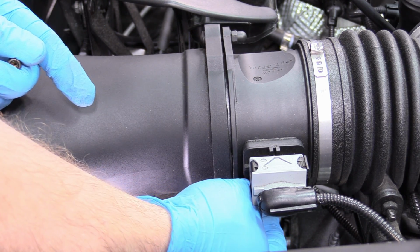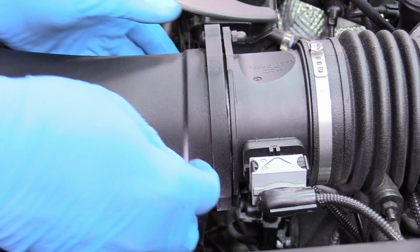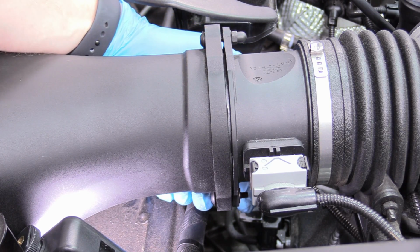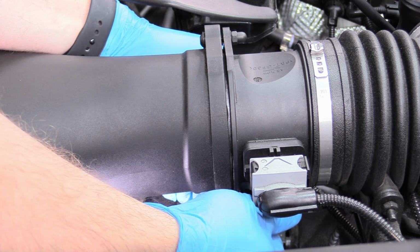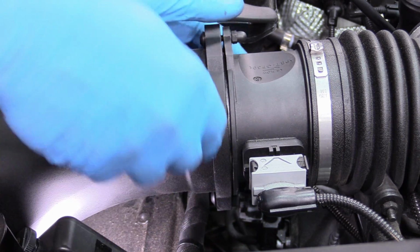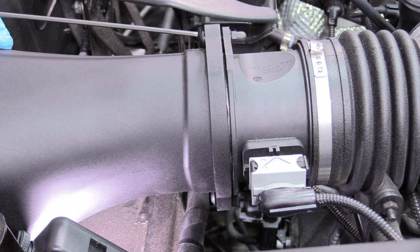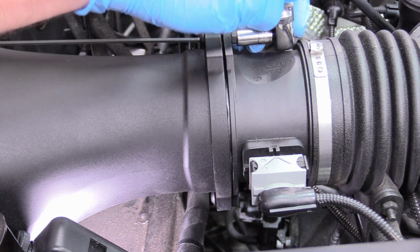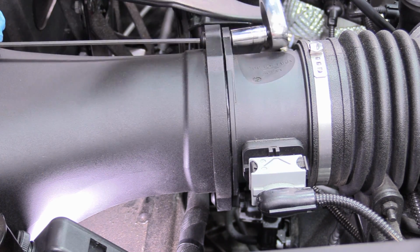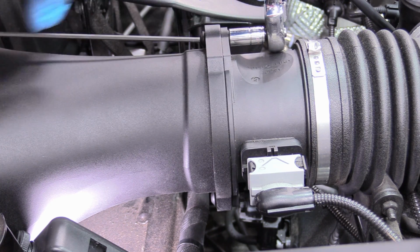And we're going to put the washer on first, and when you're putting the nut on, back up the Allen-headed bolt with your other hand, and then put on the nut. That way you don't lose your washer, because it's just pretty much an empty abyss down there. You wouldn't want to drop anything. And I'll show you how to tighten the top one. Pretty easy. You just back it up with a 3mm Allen, and then we can just tighten that 8mm down. A lot of time you don't even need the Allen to back it up.